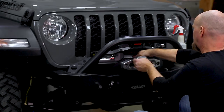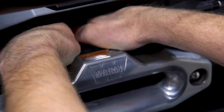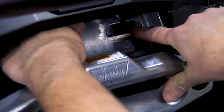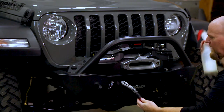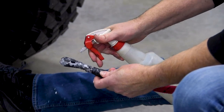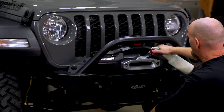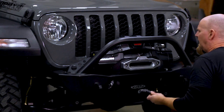If you look up on the drum itself, on one side you're going to see just a small hole, and if you rotate the drum around you'll see a much larger slot. Take your soapy water and wet the loop at the end of the winch rope — get it in there really good, you want it soaked. Squirt some down in that through passage.